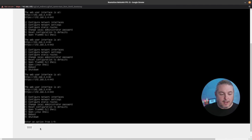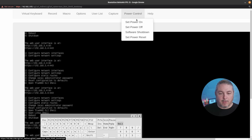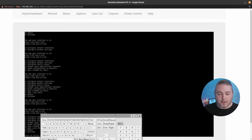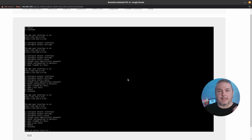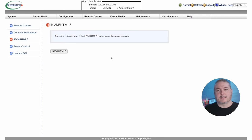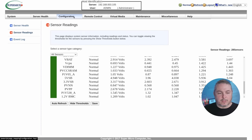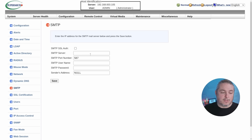It is scalable — it's showing zoomed in here but you can adjust the scaling, pull up your virtual keyboard, and look at power control: set power on, power off, reset. Jump over to preferences, scale the display down a little bit — there we go, we've scaled the display down to make it a little easier to see. You can completely administer the system remotely. Going to server health, we can read the sensor readings, see the status of all the sensors in the system and what those thresholds are, and there are a lot more configuration options.